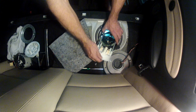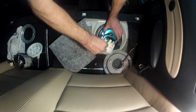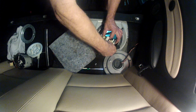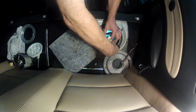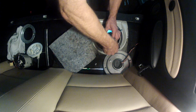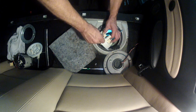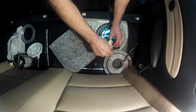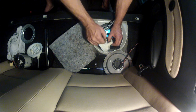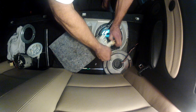I'm going to disconnect these power wires — here's how to do that. Just take the tweaker screwdriver, turn it sideways in there. There's a button on the side; push in on that button while putting tension on it, and pull it out. On this assembly you don't even really have to remove these because you can pull the whole assembly out together — I'm just showing you in case you need to.